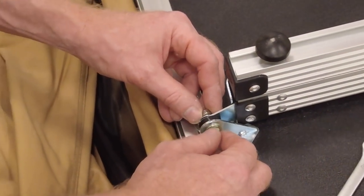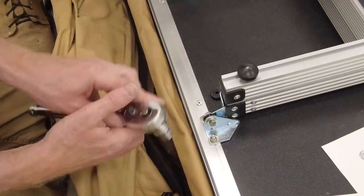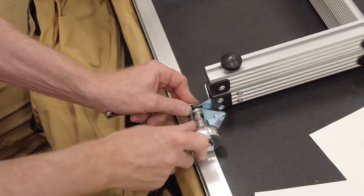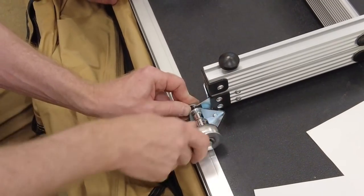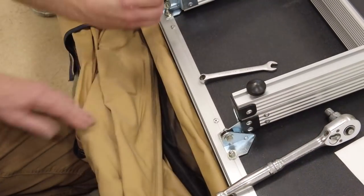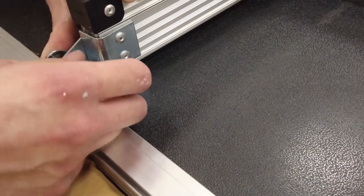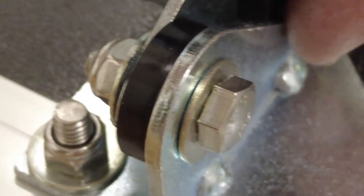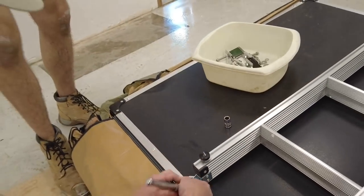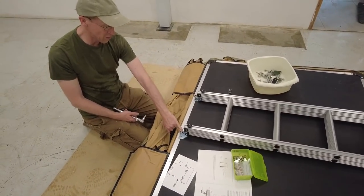I wonder Tyler, we might be fighting each other here. These don't really want to be that tight — if we go too tight I'm going to move the ladder. That little black spacer does two things: it reduces friction as you open the ladder and acts as a spacer. Because if you look down here, that bracket nearly catches on this plastic bit — without the spacer it would catch on that upright. As long as the nylon bit is on the end of the thread, they're all good.